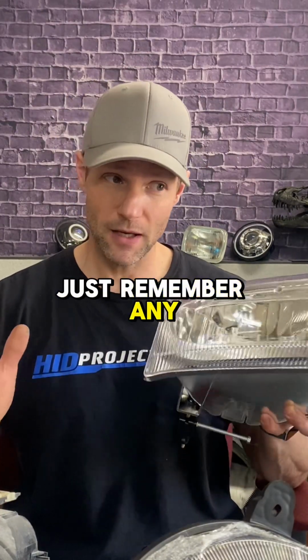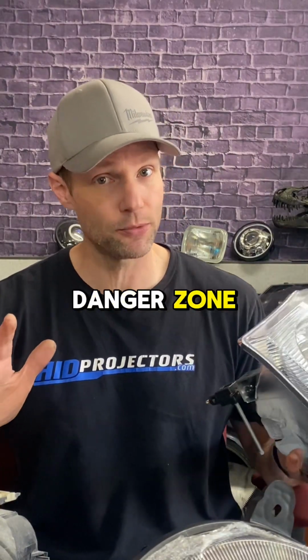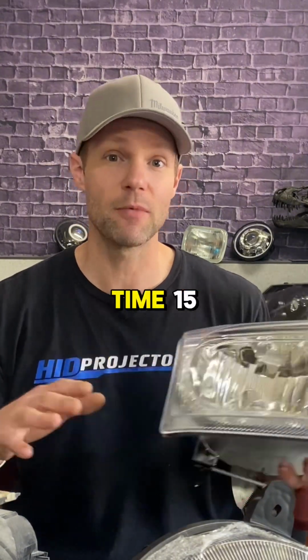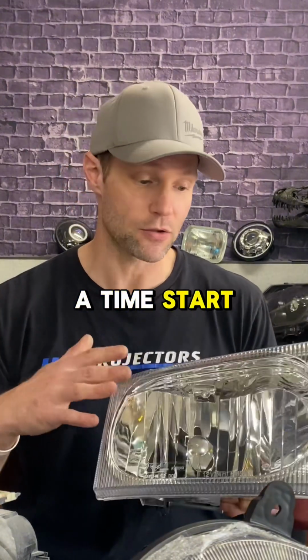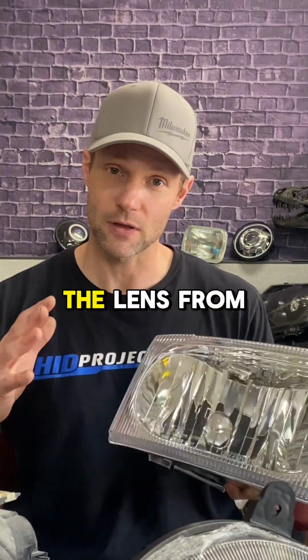Just remember, anything more than, say, 250 degrees is probably going to get you in the danger zone. Be careful. Never do too much heat. Take your time, 15-20 minutes at a time. Start to use the tools that you have to carefully separate the lens from the housing.